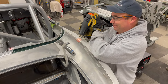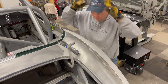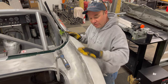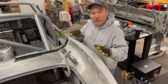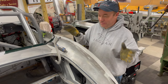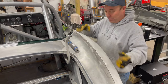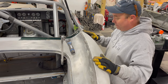It's getting there. I'm using a heat gun to get the panel bonding melted and pull this off. It would probably go faster with a torch, but I don't want to risk it — especially since this is aluminum and it's very thin, and I've got a lot of paint and body work here. I just bought a new heat gun; it's a real cheap one. I bought an expensive one once with digital controls and it didn't last as long as the cheap ones. Heat guns are kind of a disposable item. I've probably got a couple hours of this ahead of me, but we'll get these off without any damage, and that'll save us hours of repair later.